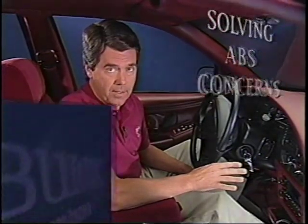With your foot off the brake, start the engine and allow it to run for 10 seconds. Shut the engine off and then restart it for another 10 seconds. If the codes recur, consult Section 5E2 of the Buick Service Manual for diagnosis. If the Tech 1 tells you that this vehicle has been previously reprogrammed and to refer to the Service Manual for further diagnosis, press the exit key.